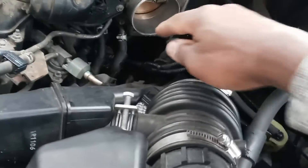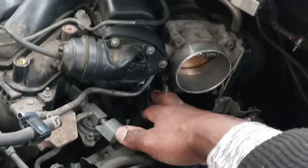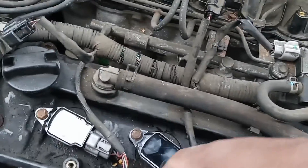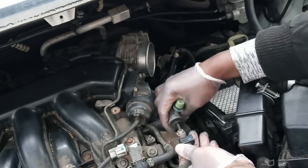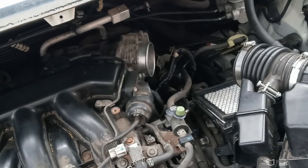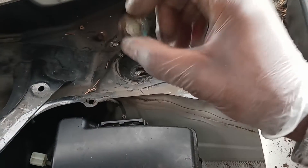Also remember, connect back your two hoses on the throttle body — always remember, this is important. Connect back these two hoses before you connect your air intake. These are pretty easy in the front, so just replace these ignition coil and ignition plug. Remember, connect back these hoses — very important. The best thing to do before I connect all 10 millimeter screws, I connect one of the big screws first — just to hold in the bracket. As you can see, I put it back.